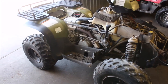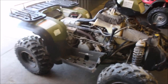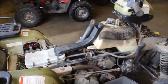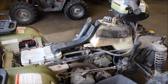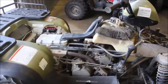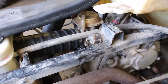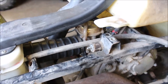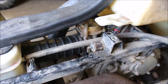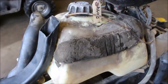Alright, so we've got the timing set. We pulled the rocker cover off, checked the cam, checked the valve adjustment — it was spot on. Cleaned the carb like I showed you in the video before — it would puke out with the airbox on. With these CV carbs, I tell you, I do not like these carbs. These depend on airflow, so it'll run great without the airbox, but once you put the airbox on you'll come into problems. The airbox isn't sealed off completely. If you've got a little foam stuck in your vent tube, that'll block off airflow.